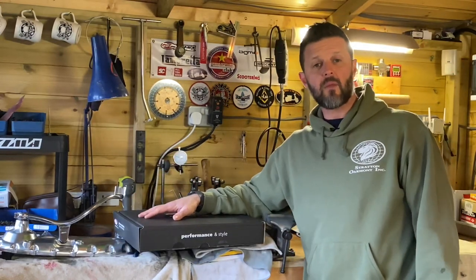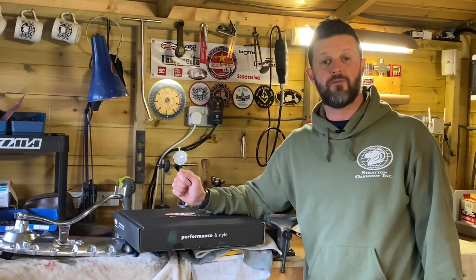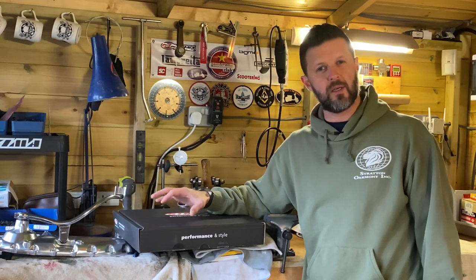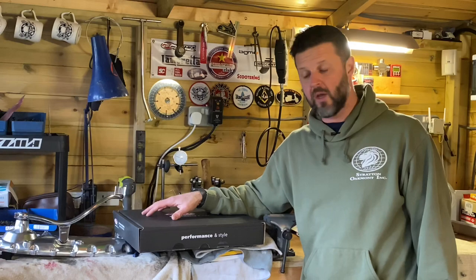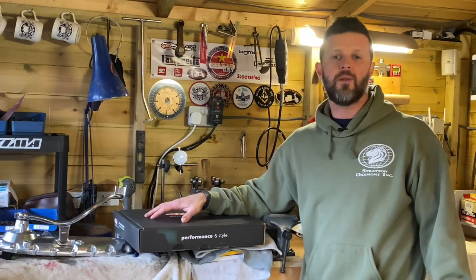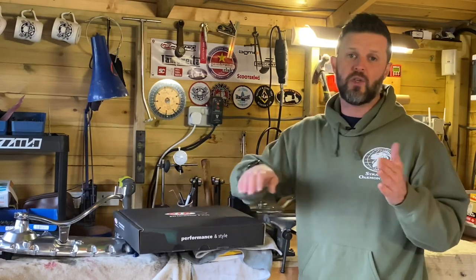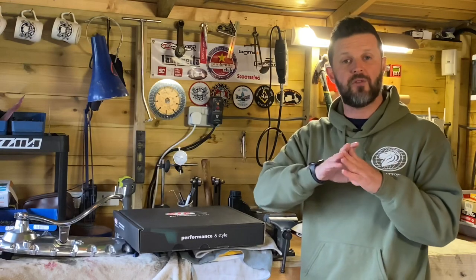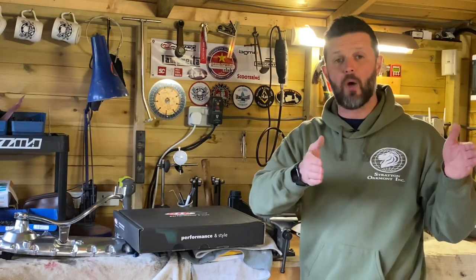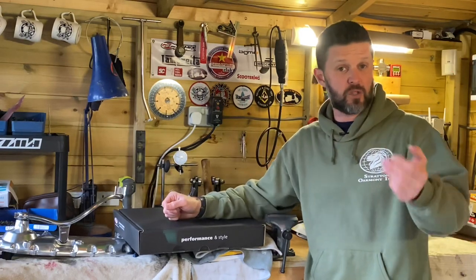The reason I've chosen the static one: a lot of people these days are going for the variable curves on their ignitions. If you've seen my other video on ignition, compression, and exhaust, I explain there that my feeling on CDI units is that if you have an expansion chamber — a fairly sporty exhaust — with a lot of power missing down the bottom end, sort of below 5000 RPM, then the adjustable ignitions can be really great for filling in some of that gap.